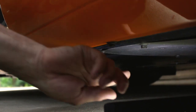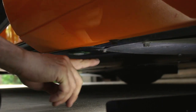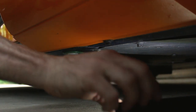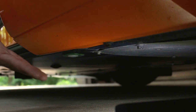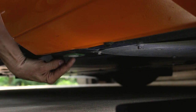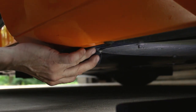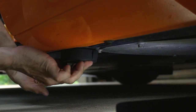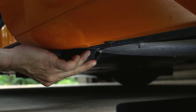Specifically, underneath the car, the carbon fiber tub terminates right where this metal plate is bolting to it. This metal plate goes under the engine. This orange part here is superficial — it is for decoration, it is not structural. There is a body plug right here, and what we want to do is position our jack right here on the corner, right by that bolt where the body plug is. Now we're going to have the strongest part of the car supporting the jack.